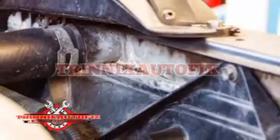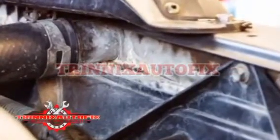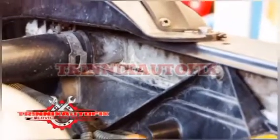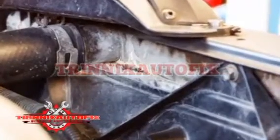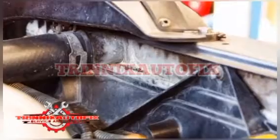In general, the right way to tighten a screw-type hose clamp is to apply pressure, but not too much that the rubber outer shell of the hose comes through the screw slot. If you go that tight, you could cut the hose. Tighten the hose and run the engine.